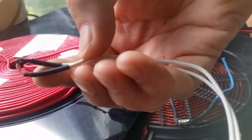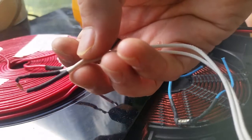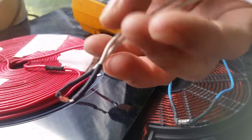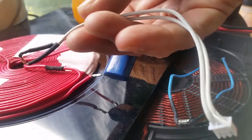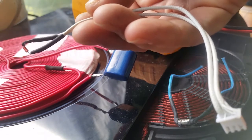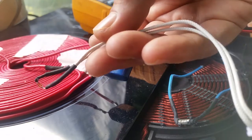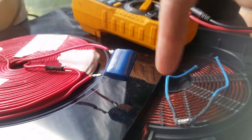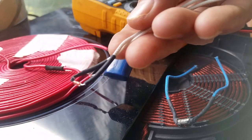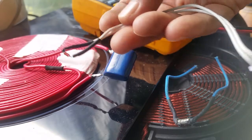So circumventing that, you could put a 100k ohm resistor across it and then plug that back into the board — chop that fella off. I'm currently looking for a 100k ohm resistor in my box of electronic junk and I can't find one. Short of that, the obvious thing to do would just be to move it into a place where it's not going to suffer any heat — not positioned near anything in the cooker that warms up — because I want it to just sit at its rated 100k until I find a resistor to replace the device.